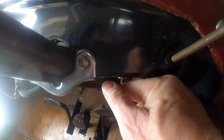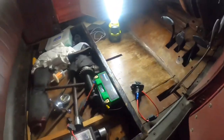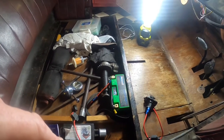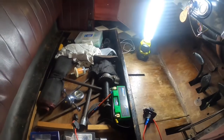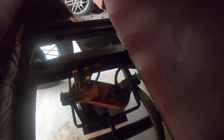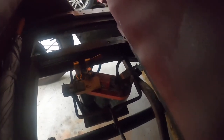That annoying sound is the blinkers. So for under a hundred dollars Australian I bought a 12-volt battery which simply powers my blinker unit. I'd probably charge it once a year - honestly it doesn't need anything. What I'm going to do is connect the power outlet to my 6-volt Optima battery with its little knife switch there which isolates it. That way I'll get 6 volts through to that power outlet, and electronic devices only need 5 volts to start charging.